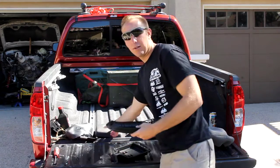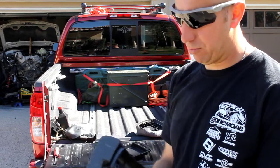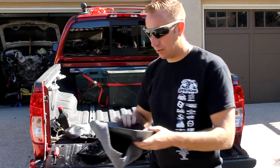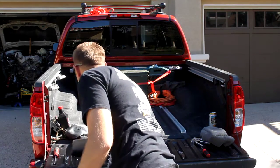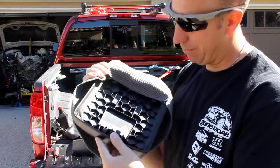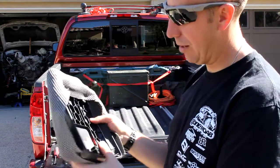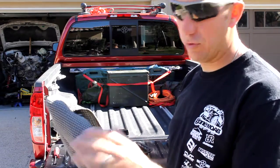Now some of the newer cars come with an armrest cover — it's a big rubber plastic piece that goes over, and it simply just pulls off. The older cars have this material; it's like a foam with a super thin vinyl on it. Either way, this will wrap over it and give you enough room to work with to get the new armrest cover on.